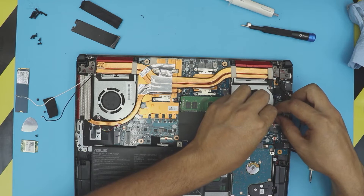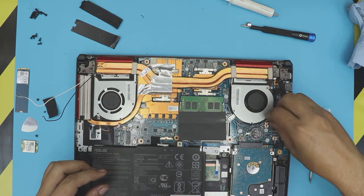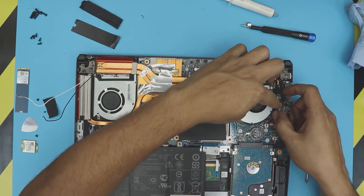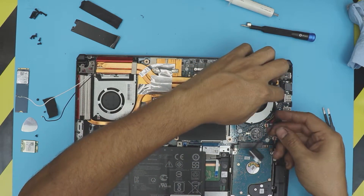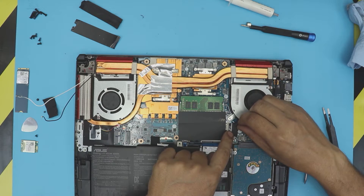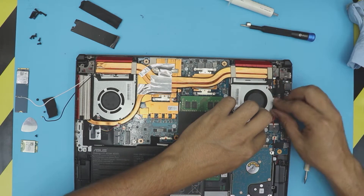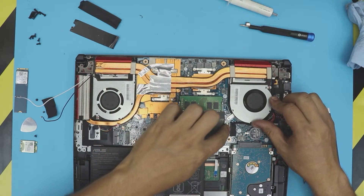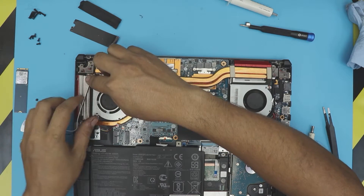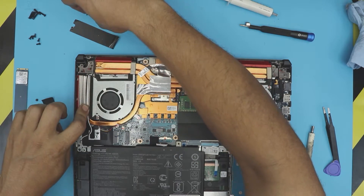Very, very important: put the cable for the fans — on this one we're going to slide the fan jack all the way in. Run the cable right across there, put the cable for the LCD, lift up this cover and just slide down the flex cable, then close the lid. Make sure the cable goes right underneath the side of the fan and it's straight in, not sideways.